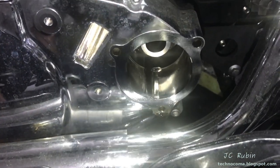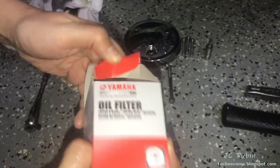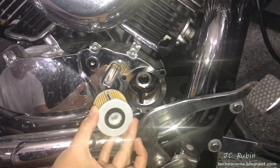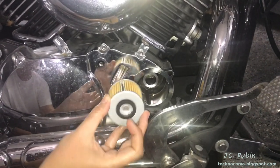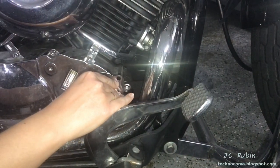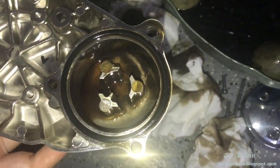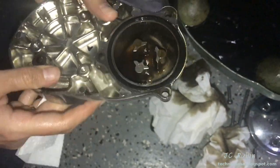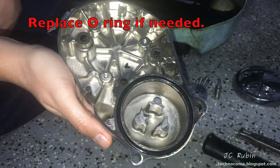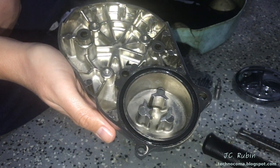She's gone in with a paper towel and cleaned out any remaining oil, soot, or debris. The cavity for the oil filter is now nice and clean. We're going to put the new oil filter in now — it goes in with the black foam piece sticking outward and the metal ledge facing inward. There's a lot of oil, sludge, and contaminants that build up right here by the filter. Once the cover interior has been cleaned up, we're going to put the cover back on and loosely fit all the screws back in before taking up the slack.